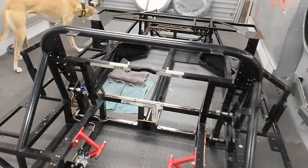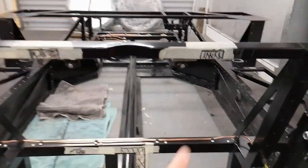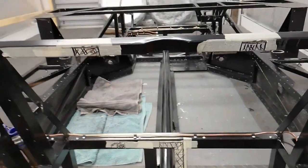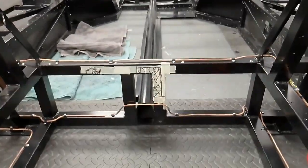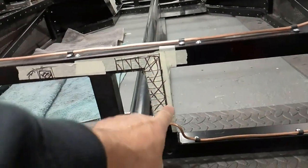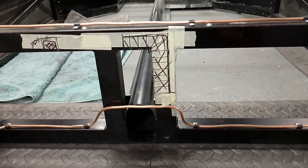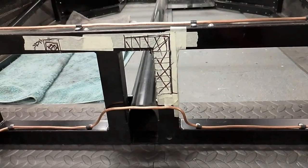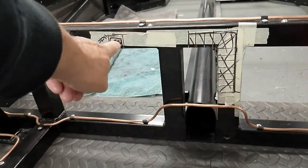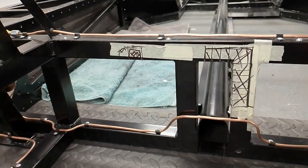I've got a few modifications to do to the chassis. As you can see there and there I've got to put a triangular cut in — that's to make room for the fuel rails. Down the bottom there I've got to cut that section out and triangulate it in to give me a recess, to allow for the drive pulley that drives the oil pump. Then I've got a little recess to cut out there that allows me to remove one of the bolts if I ever have to change the alternator.